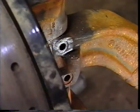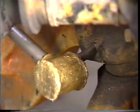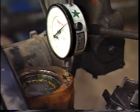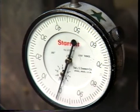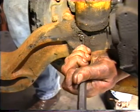Now, with the kingpin installed, install the draw keys. On the E-Series axle, the keys are installed from the rear of the axle so that the nuts will face the front of the vehicle. Use a brass hammer to lightly seat the draw keys — use caution, as they may have to be removed if more shims are needed. With the kingpin held in place, check the vertical play of the knuckle assembly. Place a dial indicator on the steer beam so that the indicator tip will contact the machined surface on top of the knuckle. Release the pressure from the jack and zero the dial indicator. Now reapply pressure to the jack. The indicator should read no more than 12 thousandths of an inch — the tighter the better. A reading between 1 thousandths and 5 thousandths of an inch is even better. The vertical play has been set. Now seat the draw keys — use a drift and a hammer to seat each draw key. Drive the key in until it stops.